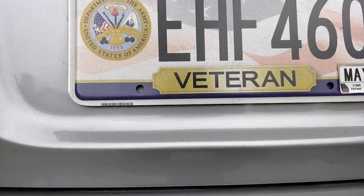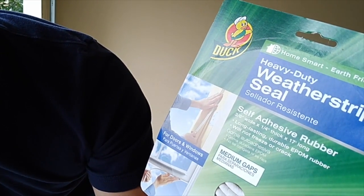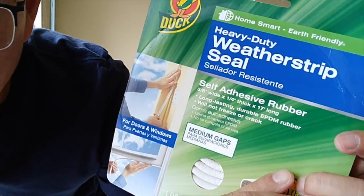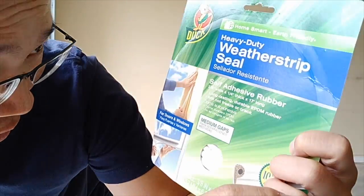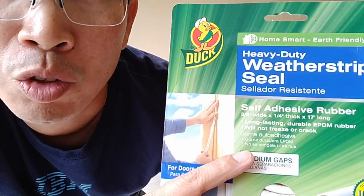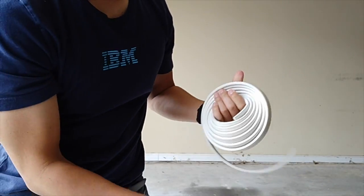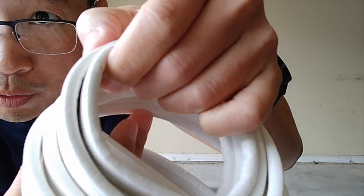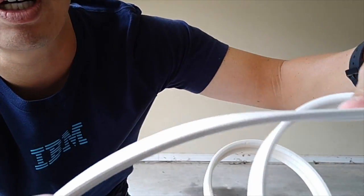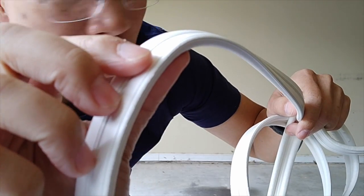So I'm going to turn this off and we're going to apply the weatherstripping. Just some things about the weatherstripping: I'm inside the garage right now because it's sprinkling out there. It's a self-adhesive rubber, three-eighths inch wide, quarter-inch thick, and this comes in 17 feet. Costs me about three bucks, so it's really inexpensive — an inexpensive way to deaden some sound. It's kind of soft, plush material. I'll crack it open. It's kind of soft, foamy feeling, and it's got some adhesive right here. You peel that off and go. I need a knife — I'll be right back.